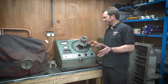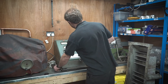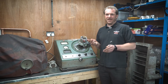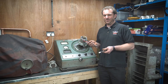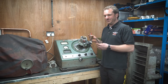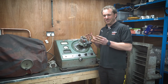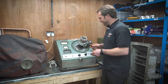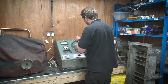To adjust it, it's just like adjusting a normal set of points — pretty easy. Get your feeler gauges and screwdrivers. For this you've got a range of 0.3 to 0.4 millimetre to work with as the points gap. You'll probably have one set of points at say 0.3 and the other at 0.4. What you're really aiming for is to stay within that range, but most importantly get your ignition events at the exact right timings. Let's start off by adjusting it back a bit to the middle of the range.